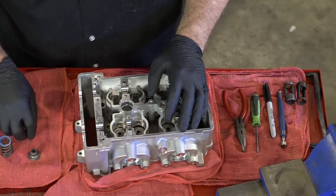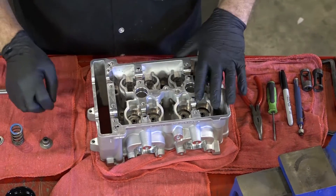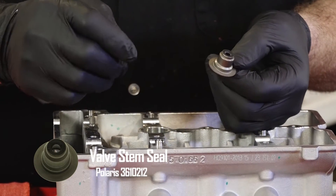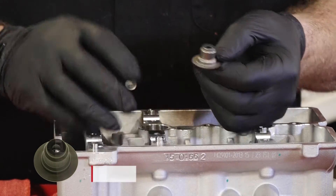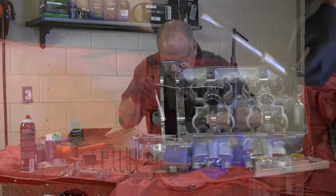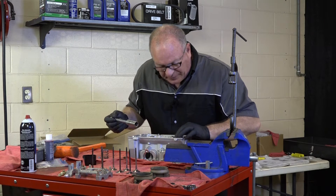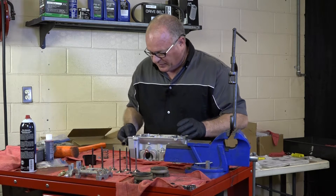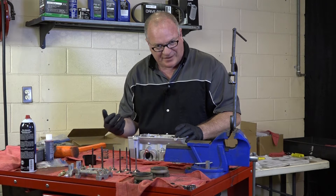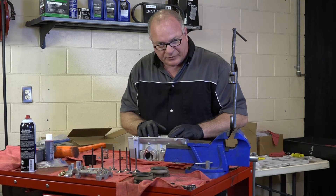I want you all to be really careful about this. The older type heads use a small seal, but this is one of the newer type heads and it uses a completely different valve stem seal. So make sure you get the correct part number if you're replacing the head. To get them on there, we're going to use a socket, make sure it's lined up evenly, and just tap it into place. Not a lot of pressure required — it's basically replacing the seal and that lower seat that the old springs used.